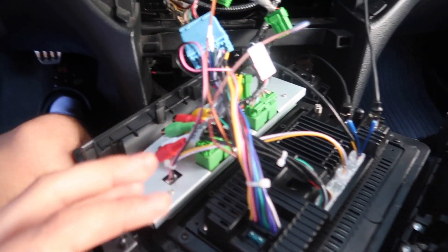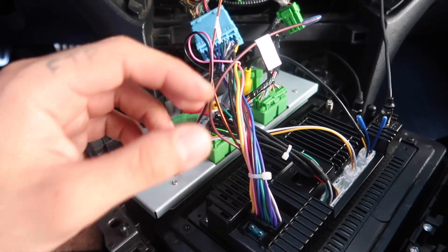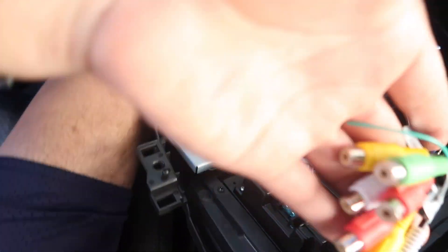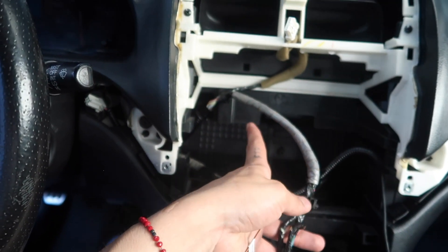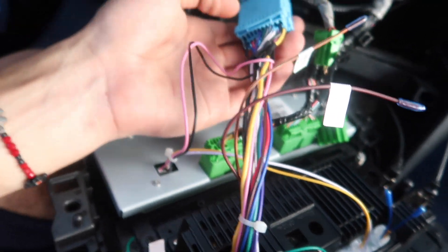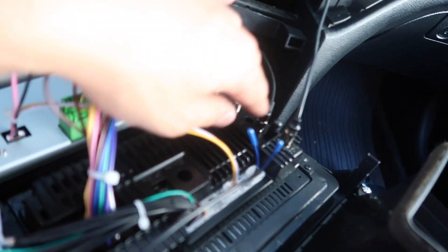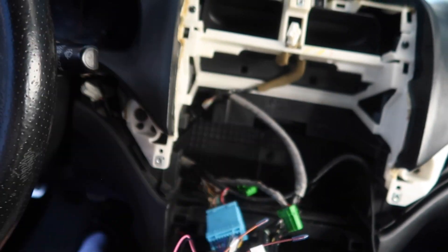Before I put everything back together — also if this video was helpful, please give it a thumbs up. These connectors are probably for subs and backup camera and all that. From the top, coming from the unit, only this little green one connects to the big unit, and then this one connects to your AC and stuff like that. This blue one connects to this blue one right here. These two I didn't connect — there's nowhere to connect them. Then obviously connect your antenna and don't forget your GPS. That's basically it. I'm gonna go ahead and connect the battery and see if it starts up.